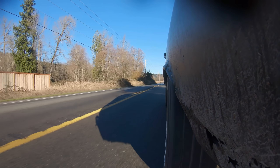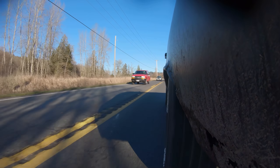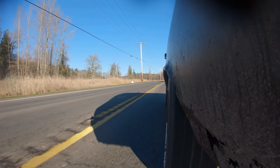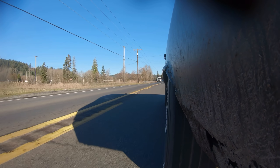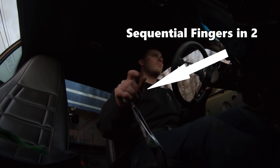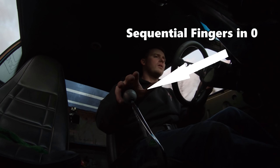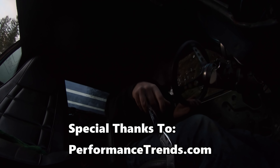Running too lean — 15, that's too lean. As per usual, we must unfortunately end on a low point, because stepping up the jets made no change. So we've got to order some parts before we can get this thing worked out. See you next time. Lost my window roller back here when I pulled out — I think it fell out through the hole in the floor.